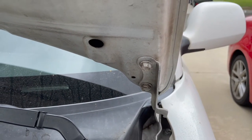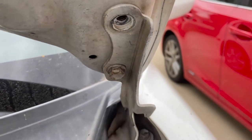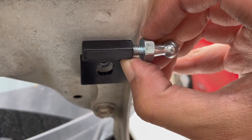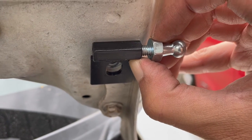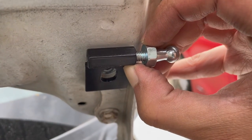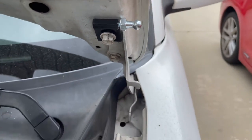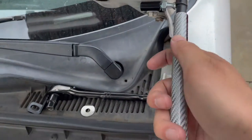See that bolt's off right here. I'm gonna put it right here like that and adjust this ball screw out a little bit so you can turn it in and out to adjust for clearance. I'm gonna bolt this up right now — this is how it's looking, how it's mounted. Then I come back with the strut right here and I push it in.